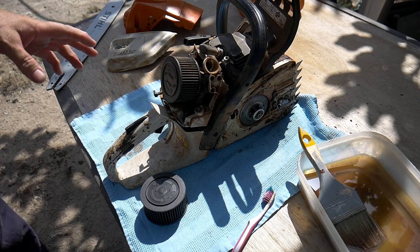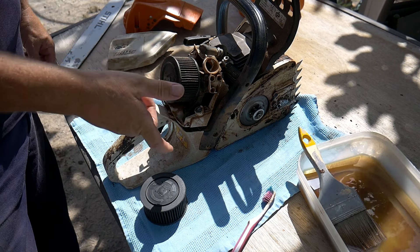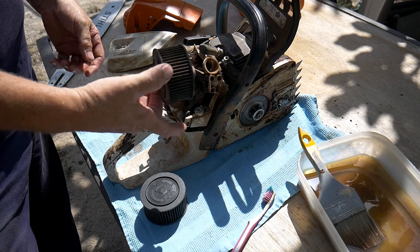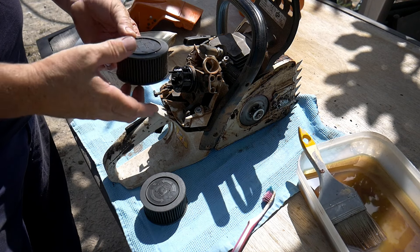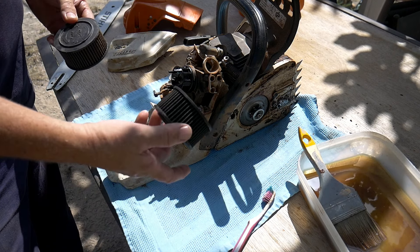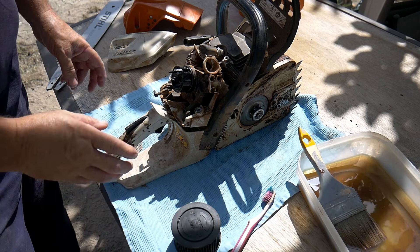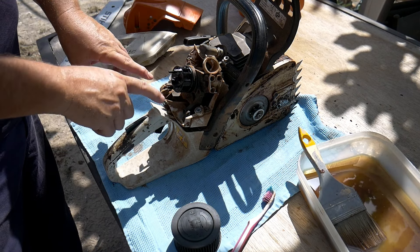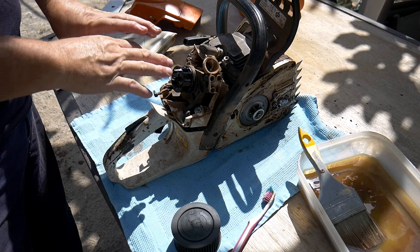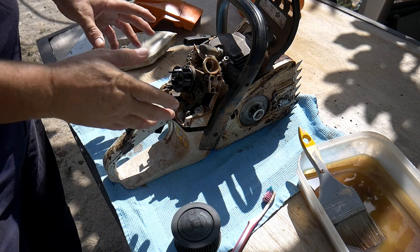Now comes the time to clean the area of the air filter. For the air filter, you can clean it with the compressor — if you have one at home, great. If not, you can go to a petrol station. Mine are washable, so I will simply take it off, wash it and wait for it to dry. It doesn't matter because I have several, so I just simply swap it. So while it's off, I will clean that area the best I can, making sure nothing enters the opening. Once it's clean and wiped, we'll be able to place back the filter and continue with the machine.